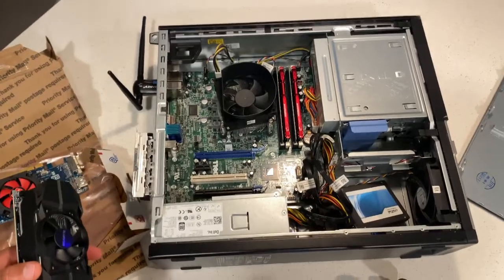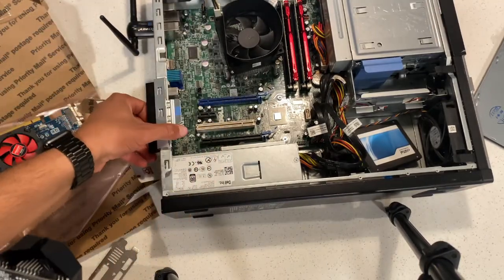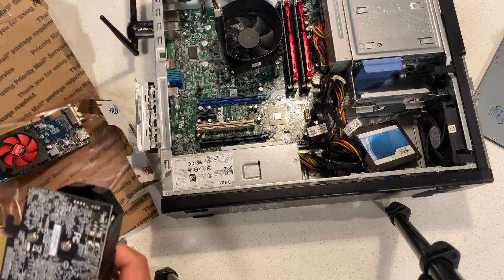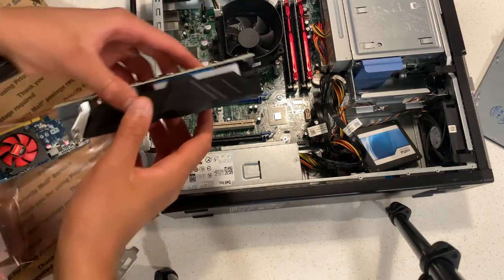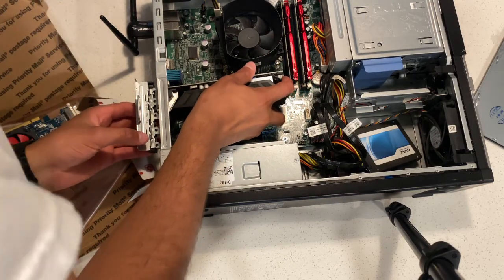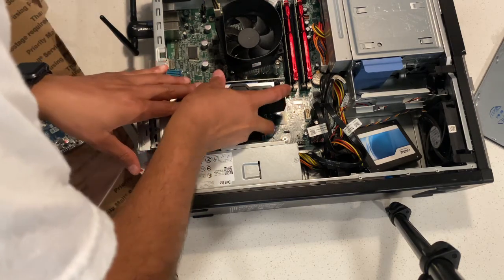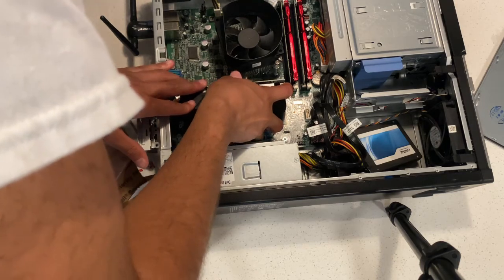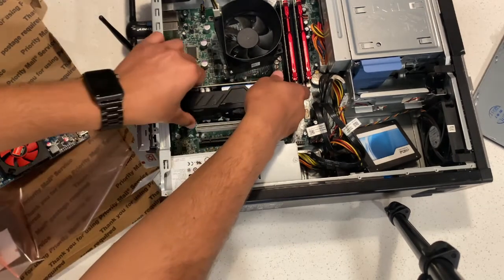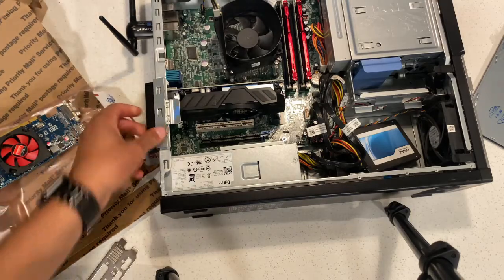We're going to move the camera in a bit. You're just going to pop it in to the top slot. Pop off the graphics card case, remove one slot, and you'll be able to pop it in just like this. It takes some fidgeting, but eventually it pops right in. Just line up everything, and then you'll hear a little snap and it won't come out. And you need to close that up when you're ready.